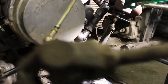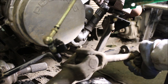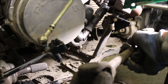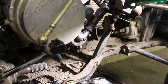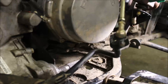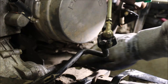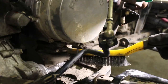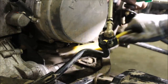Same with the front drive — this thing was a pain to get out because it slides back, comes off the front differential, and then you've got to slide it forward. It only goes back so far and I barely cleared the front diff to get it out. Another little trick: I put grease on the shafts, clean these splines up really good, and throw some grease on there. The cleaner you get the splines, the easier this is going to be to go in.